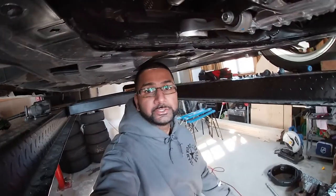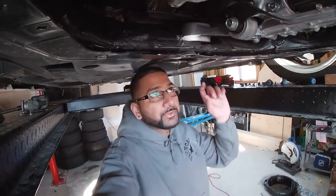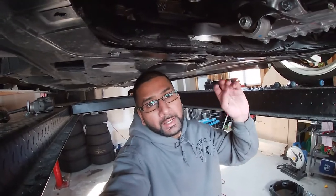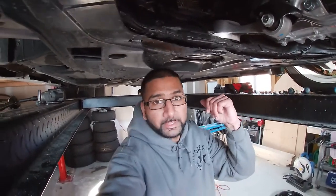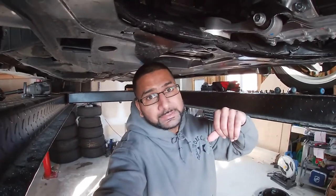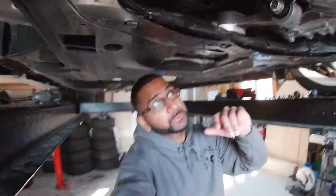And as you can see for the front pipe, after I loosened the three bolts, I twisted it, let's say if I'm standing this way, the front of the car is that, the back is there. So I twisted it clockwise and tried to take it out, but then the heat shield was in the way. So I hope I can get this.